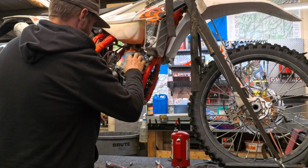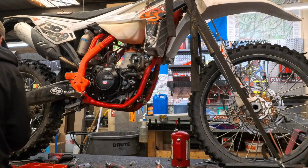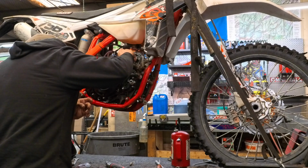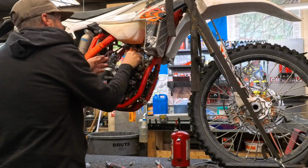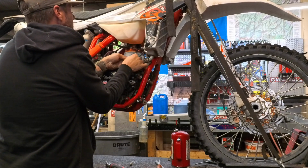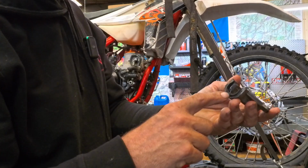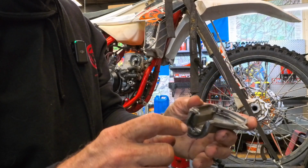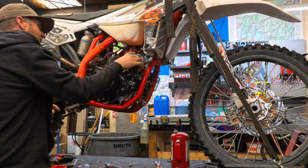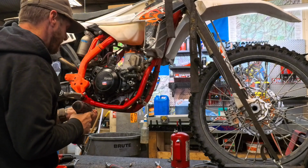All right, guys. Next, before we put the cover on, we're going to take our power valve cover. We're going to install our little clip. It's like every other one of these things. Being careful not to drop the clip into the transmission. Then on this one, you can see I put some Ultra Black on here before, it's RTV silicone. I'm just going to leave that on there because it actually kind of made a gasket. And there's already an O-ring, so I'm going to slide that on. We already put the clip on and all that.